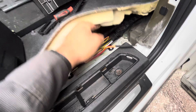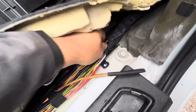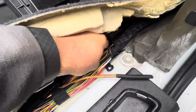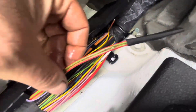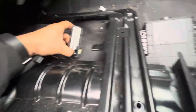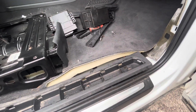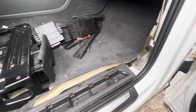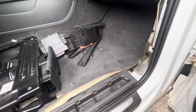What I wanted to show you is this is a common break — this is what powers up the trans module. It goes from this heavier gauge wire, this red and green wire, to these two red and green wires, and they power up this trans module. That goes right to this connector here, and it's a common problem.